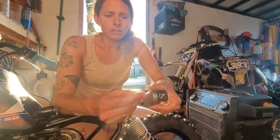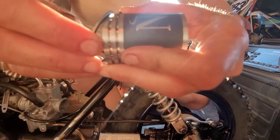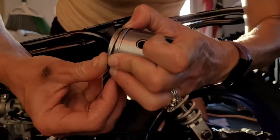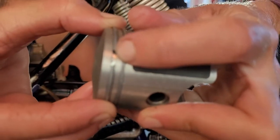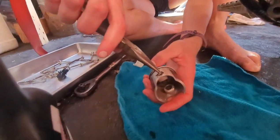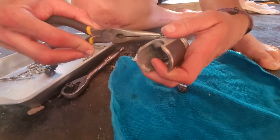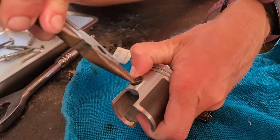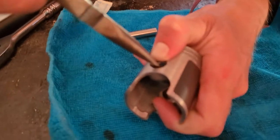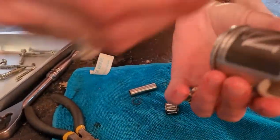Alright, so we're going to put our rings on. This says 'top' so it's going to be facing the top and you have a little nook — just hold it in there. We're doing the top one. You have the opening on that little nook, and that's where you want to keep your rings. Now I am going to put one of the little clips in on one side before I put it on. Try to get it in the little grooves there and push it in. You always do one side first so it's easier instead of it being on the crank.